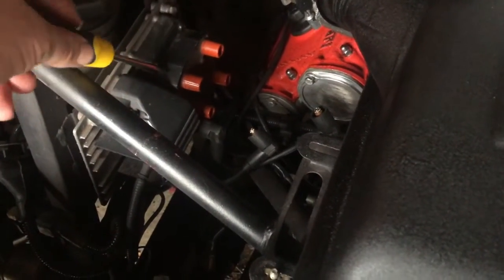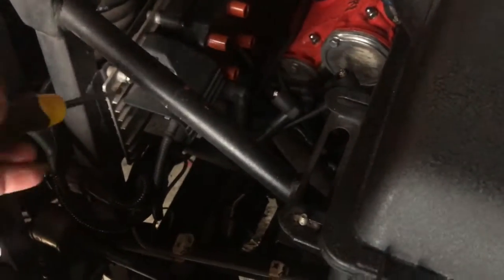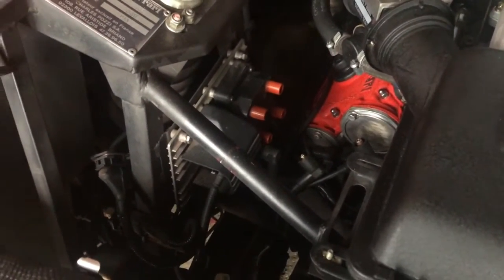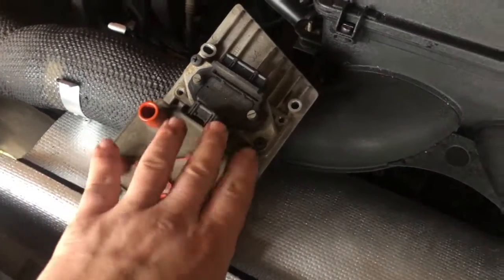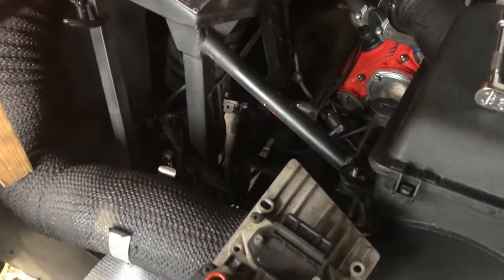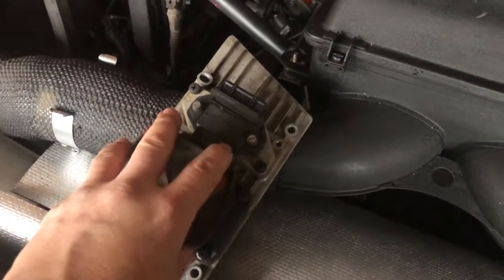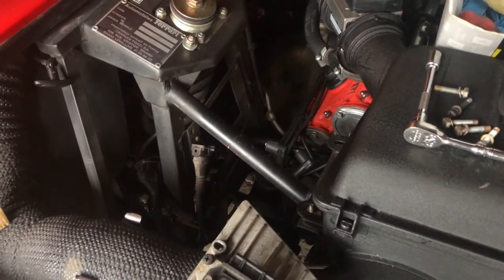Just connected and disconnected all the leads off the coil. Taking the cables out here — I'm going to remove the four 10mm bolts from around it and take it out of the car, which is easier to clean. That's out of the car now. I need to replace this coil anyway because it's slightly broken. It also lets me get to things like the spring and the frame and give all that a clean up — four screws, two connectors, and a cover. Well worth doing.